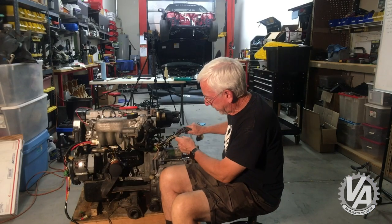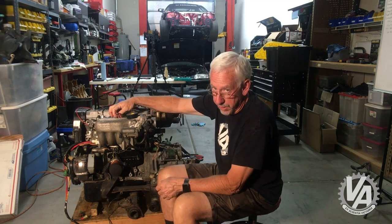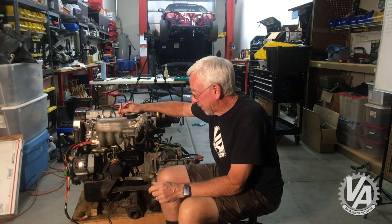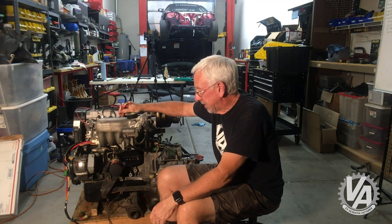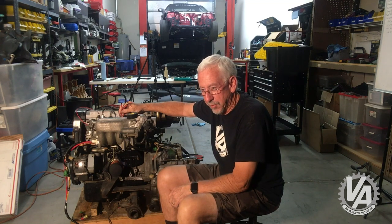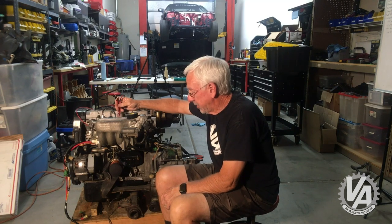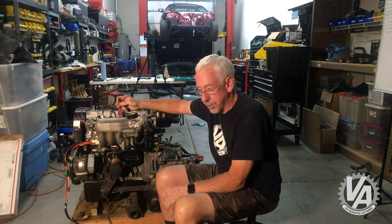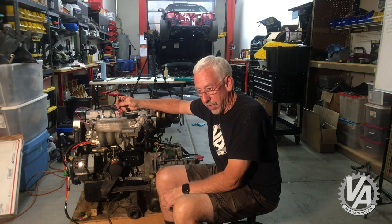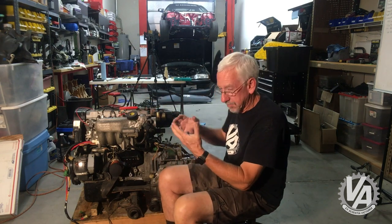Everything has been fitted, taped, and I think I feel pretty good about the way it all fits. The only thing I wasn't able to do — and this was actually a couple-day project — was put in the injector plug. It turns out I don't have any Honda terminals. I thought I did. I went online and found something I think is going to work. But that will be in a later episode. This is the funny thing about YouTube: literally this job would have taken me probably three and a half to four hours to do, but because I'm trying to film it as well it took forever — probably about eight and a half to nine hours total over the last three days. Anyway, I have all the wires where I think they should be. The only thing left to do is tape it up and loom it.